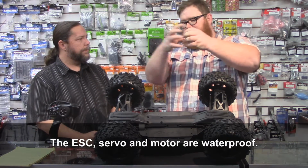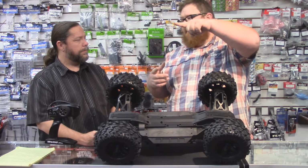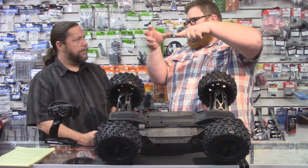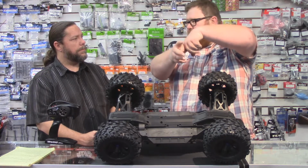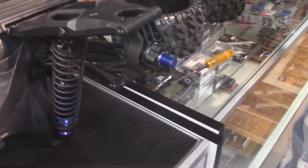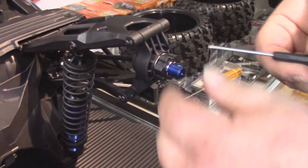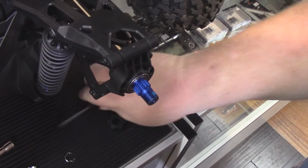When the drive hex slides onto the axle, everybody does it where you have a single pin, and then there's a female part for the pin on the hex. The hex slides over the pin, and that's how you get drive. Gotcha. Yeah. Well, that puts a lot of stress on everything, because you have that one single pin. And as a lot of you Yeti XL owners understand, that single pin design stinks because you're constantly breaking pins or breaking hexes when you're in really, really heavy-duty situations.